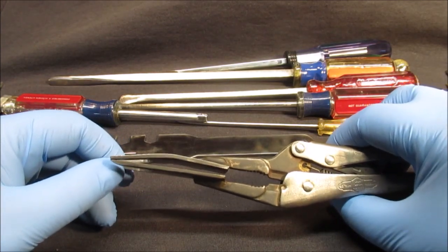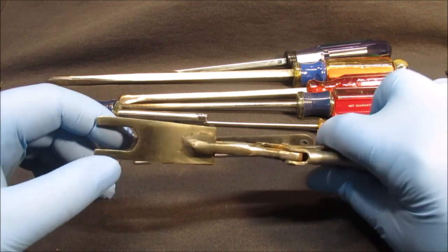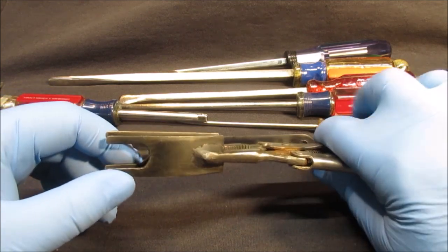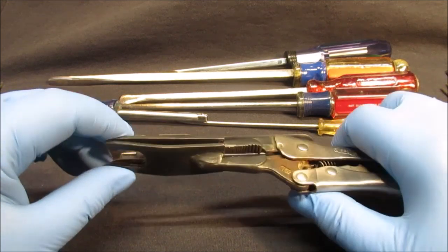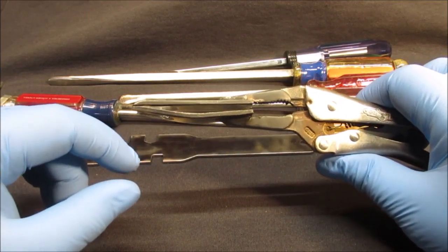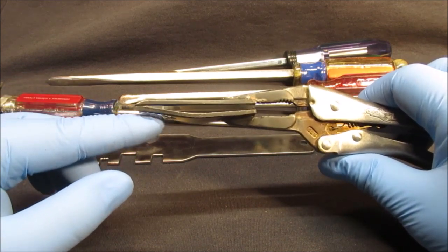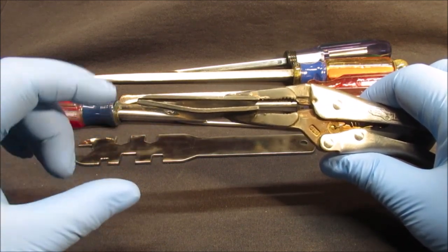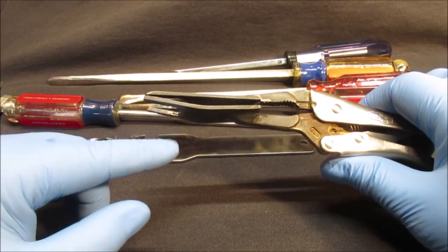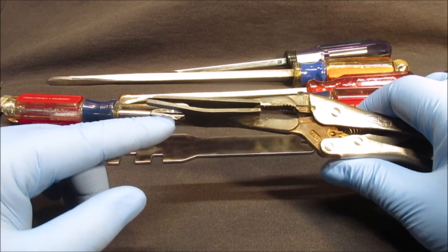most important tools I made. This I made valve spring compressor when I worked on my 16 horsepower Briggs. And it was very hard to work on because it had the little half collars like on a car head. So I had to compress the spring quite a ways. Plus it had a rotator on there which made it taller. And I had to get those little keepers up there with grease and a stick and everything else.